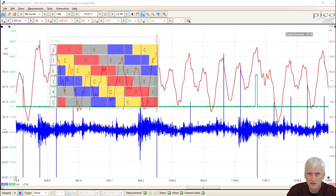A lot of technicians, when they do have a drivability issue, a misfire, a random misfire, or something along those lines, will do a cranking test. They'll disable the ignition or the fuel, and then they'll crank it and check the exhaust, because the cranking event will be a little slower. The patterns would most typically be a little bit more even, and you might get a little more clarity and see if there's a cylinder that's not doing its job. But like I said, there's no drivability issue on this one. I just wanted to experiment.